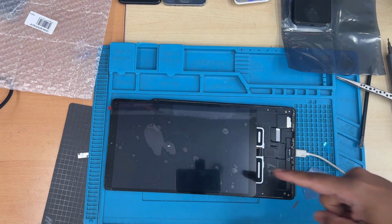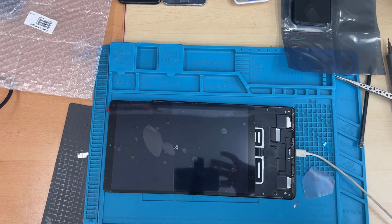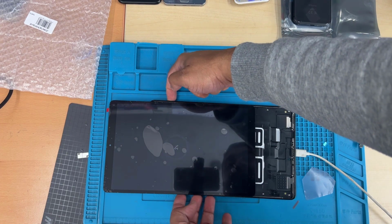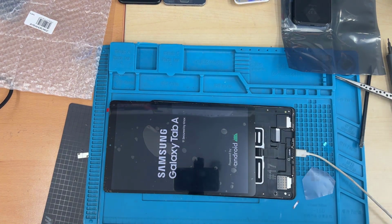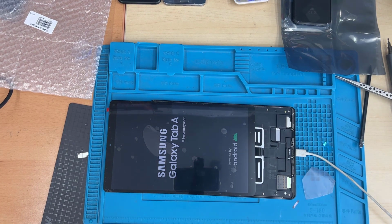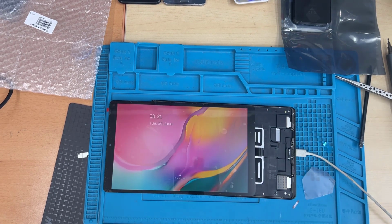Okay, here one of the mistakes that I done, I left the machine on while I disconnect and reconnect, which is terribly dangerous. Okay, the reason is it was not switching off because I don't have the password. I don't hold the password that is from one of the customer. So I had to take the risk, but for your situation, I would suggest you switch it off before we disconnect or reconnect any sort of internal cable.